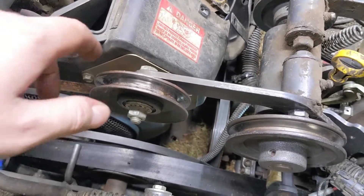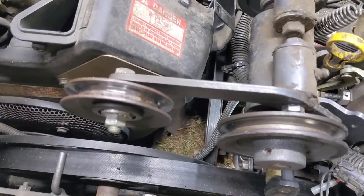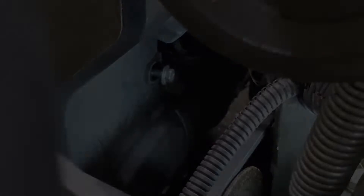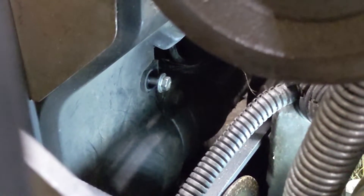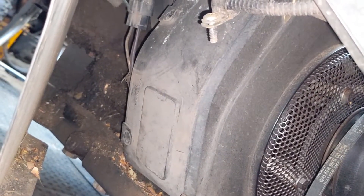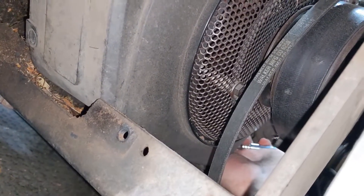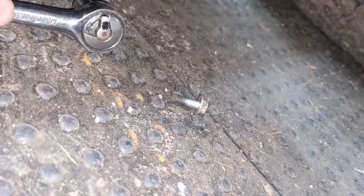So a little update: I went ahead and pushed down on the idler pulley so that I could disconnect the drive belt, and that allowed me to go in from the side with just a quarter inch ratchet and I managed to get the bolt out. On the back of the engine case there was that lower bolt, and it turns out there's one at the front as well. Luckily I was able to take my ratchet underneath and little by little I got that bolt out too.